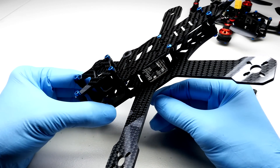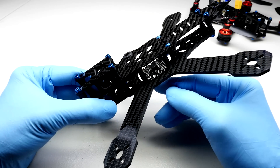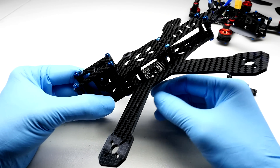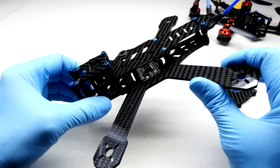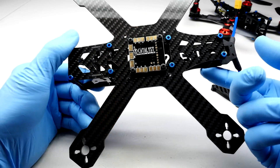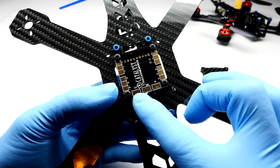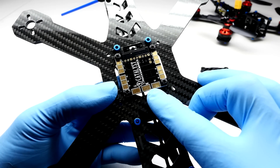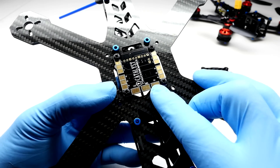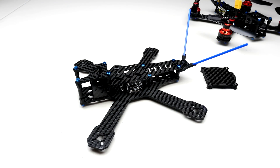You plug in your video camera, you plug in your video transmitter, you wire in all your ESCs, and you even plug in your OSD. It's one central location. There are filters in-line with all those things so you get clean power — no video interference from voltage spikes and things of that nature. You can also see step-downs here: a 5-volt step-down for your flight controller, and a 12-volt step-down if you have LEDs. These are also filtered. That is a really neat feature of the Speed Addict 210-R.